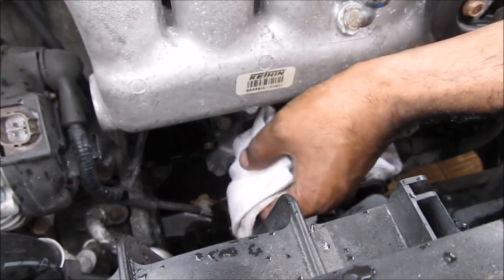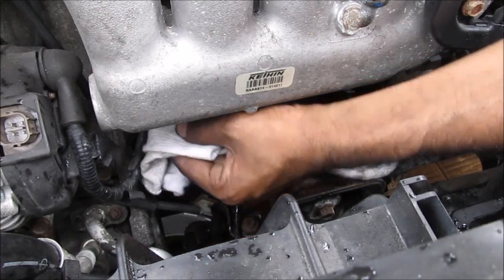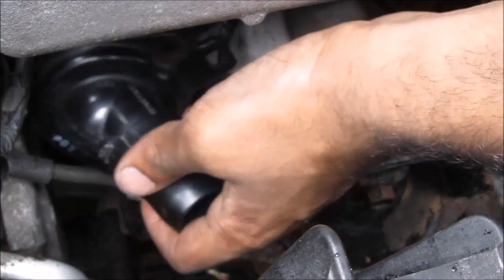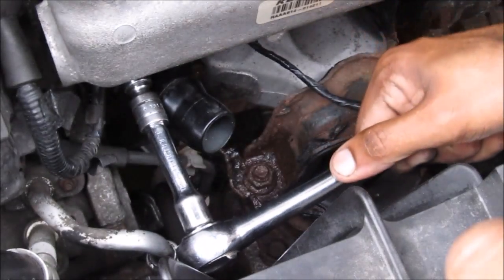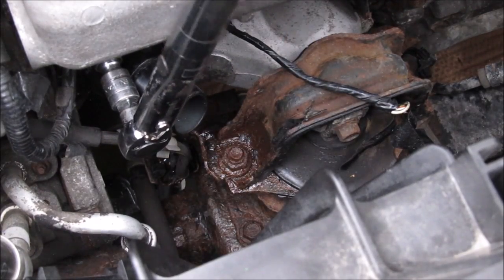You can see the three bolts there. Before reinstalling the gasket, use a cloth with a little bit of brake cleaner on it to make sure the mounting surface is nice and clean so it will seal properly. Then go ahead and replace the thermostat into the engine block, and once it's in position, start threading in the three 10mm bolts.